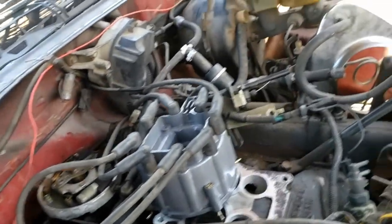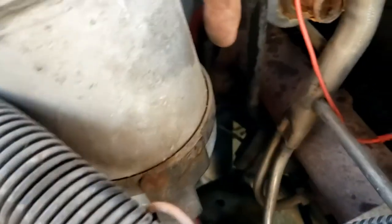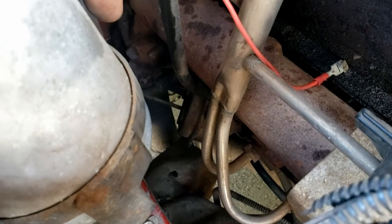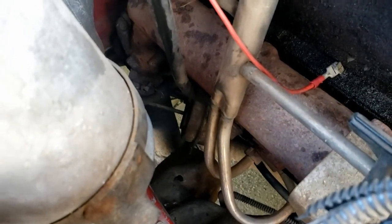There's nothing else being used, vacuum or the advance. Yeah, the vacuum advance, nothing is proper. Some of you know that there's a dampener down there, or some type of butterfly on the exhaust, which I've always ripped off because they're always frozen. That one is also frozen. So we're gonna see if I can make it stick open so that it's breathing properly.